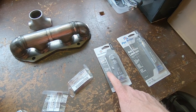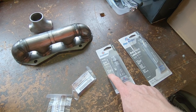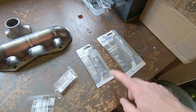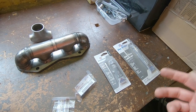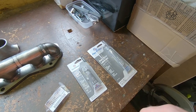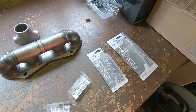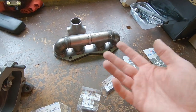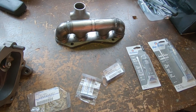I'm going to use nickel anti-seize on them because nickel goes up to 1300-1500 degrees C, whereas aluminium anti-seize only goes up to about 870 for these particular brands. So nickel for high temp, aluminium for where copper isn't suitable, and copper for everything else because it's cheap — but you have to be careful because copper shouldn't be used on stainless as it can cause galling. None of this is stainless, but it's simply not high enough temp.